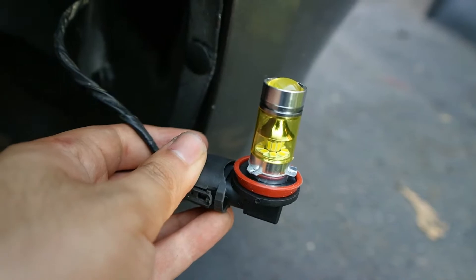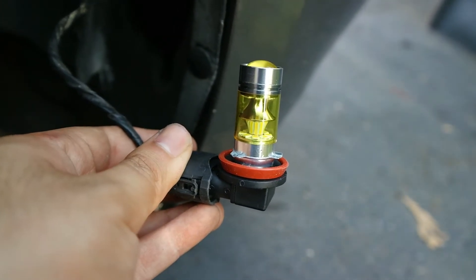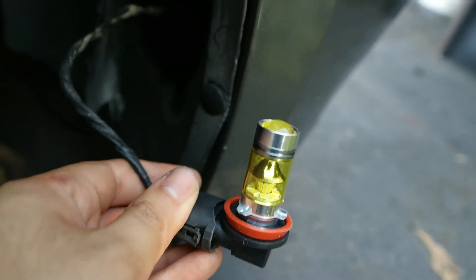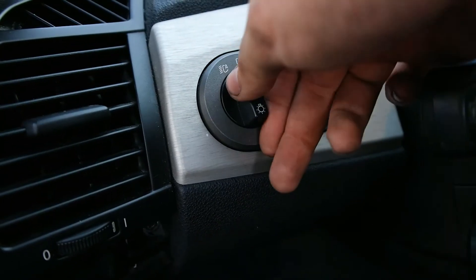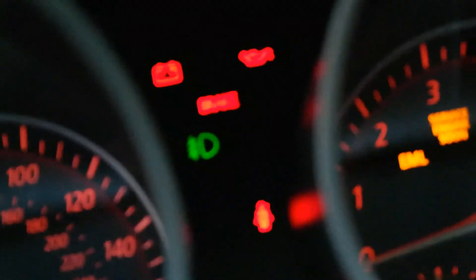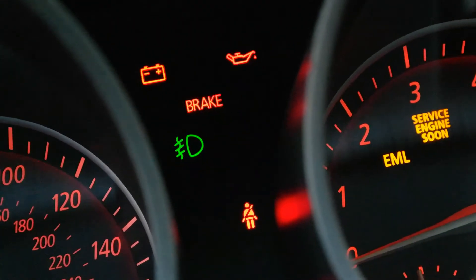Then you remove the light from the electrical connection. When installing your new fog lights, plug it in but don't touch the light bulb — just touch the bottom plastic part so you don't damage it — and then tighten it. I believe you turn it towards your right to tighten it, and it's a very easy process.